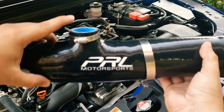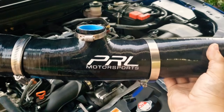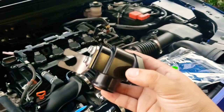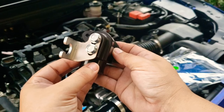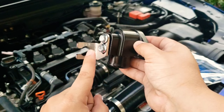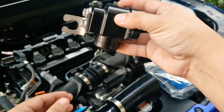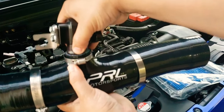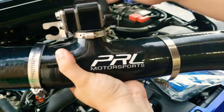Place the socket here at the flange. This piece goes in the center — I'll keep calling it the flange ring. What you want to do is put this bracket right here with the two screws. I wouldn't tighten it just yet because we've got to maneuver this correctly. On this hole you're gonna use a stock screw, which I'll show you. This part is gonna go on top of the actual intake to secure this whole assembly onto the vehicle — everything starts making sense once you start assembling it.